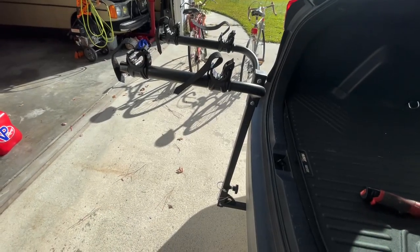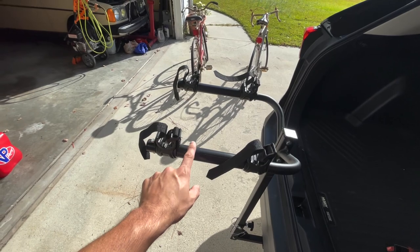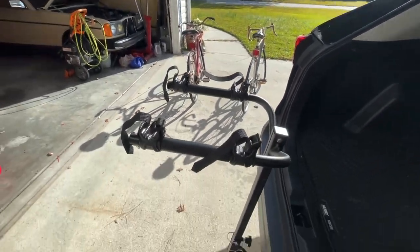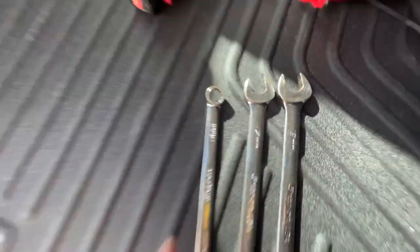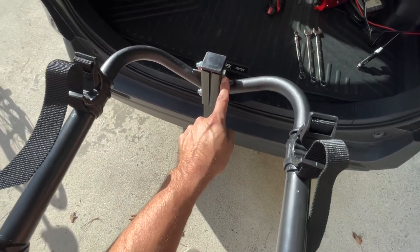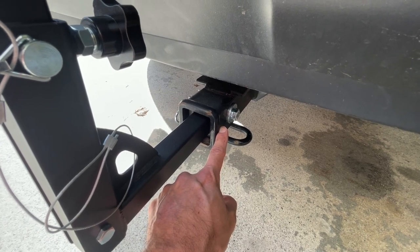You will need some tools to assemble this and install it to the vehicle. Here's a shot of it with no bikes on it. I do wish these upper bars were just a little bit longer, because that handlebar did rub against the hatch light. While you're at Harbor Freight picking this up, go ahead and grab yourself a 14, 17, and 19 millimeter wrench — you will need these for assembly. The upper screws are a 17 and 14 head, and you'll need a 19 millimeter wrench to thread the pin through your receiver and into the bike rack when you install it.